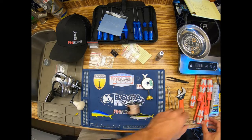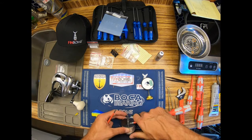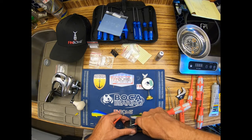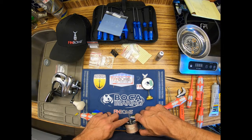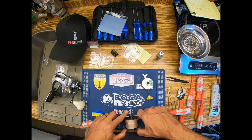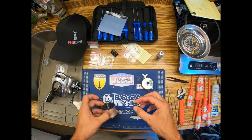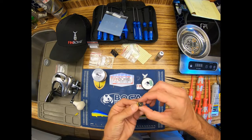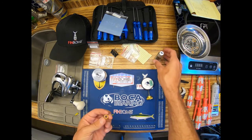That's how I have pulled these apart, and it's pretty easy. You might have a better way, go for it if you do. If not, I take this guy and get it closer to the front, and then gently on either side with two flatheads, push with even pressure to move this bearing off, and it comes off smooth and easy. If you haven't memorized every bearing size out there, take your bearings and put them up next to your kit and just make sure you're using the right one, and you put your other bearing back.